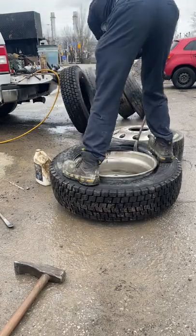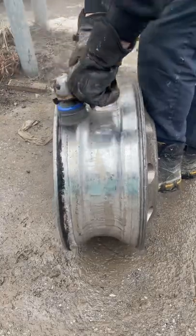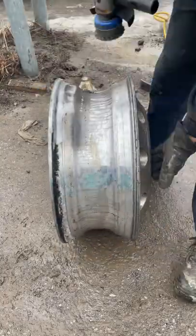Important steps to make sure your new tires don't fall off or go flat. Grinding down the excessive corrosion on aluminum rims — if you don't do this, then in a month, your beads will probably be leaking.